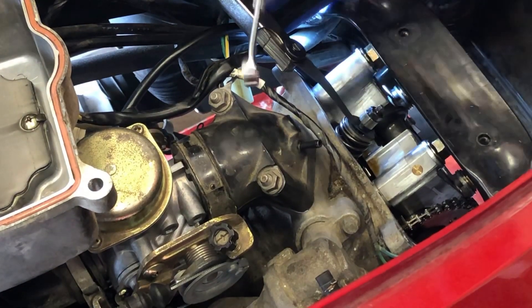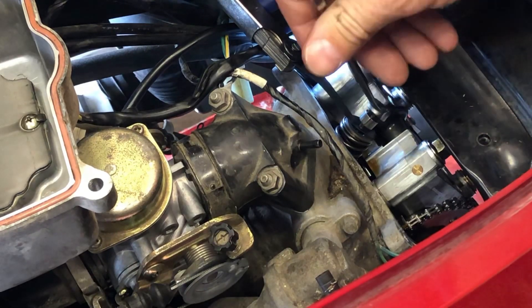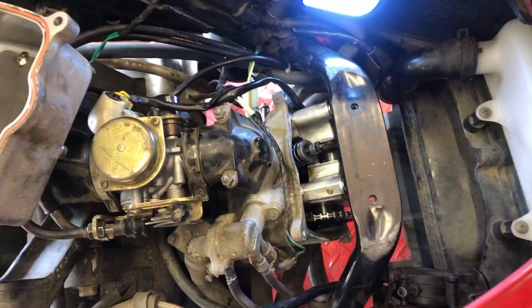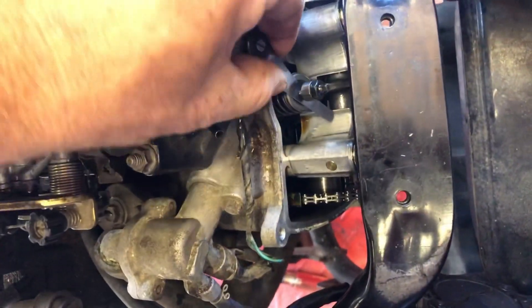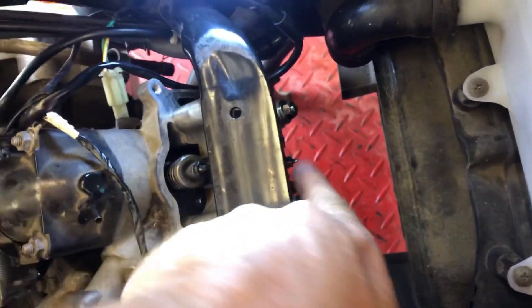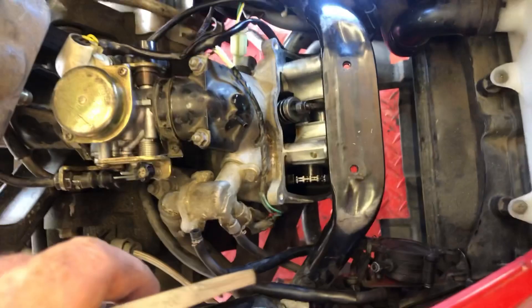Sometimes you can hold the adjuster with needle nose pliers. Put the wrench on the lock nut and hold the center part with the needle nose as you tighten it up. Sometimes you have to go back and forth a few times — a little too tight, a little too loose. There we are — the feeler gauge is passing through with just a slight amount of drag. I already adjusted the bottom one too, which was much harder to reach. That one down there you can't quite reach from the top or the bottom unless you're laying on your back under there.